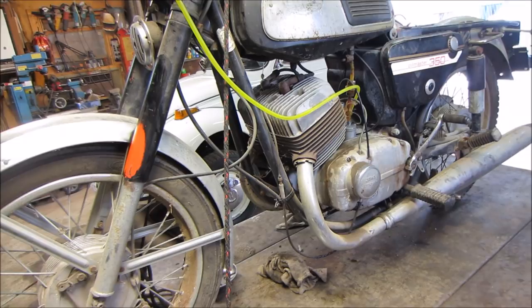It's the next day and I was trying a bunch of different things to see what would work for loosening the paint. I went to Home Depot and scoured the aisles and grabbed a graffiti remover. It seems like it's tacking up and working, but the gas tank area seems like the paint comes off much harder — possibly it was painted with an automotive type of paint. I went back to lacquer thinner. I took a paper towel soaked with lacquer thinner and put plastic over the top to keep it from evaporating, but unfortunately it's taking the lower level of paint off too. So I don't think that's going to be a viable solution either.